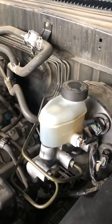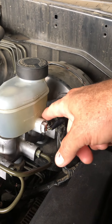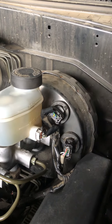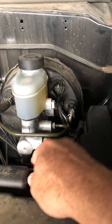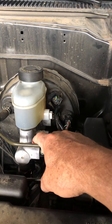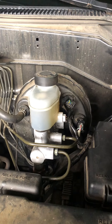The other thing I did while I was doing this — because the theme seems to be that the electronic connectors are getting dirty — is I cleaned the sensor to the float valve, and then I removed the connectors to the brake booster and cleaned them as well. I'm not sure this is a permanent fix. My plan is to come back next time I'm with this vehicle with the pressure sensors and the master cylinder ready to replace if needed. I hope this helps you out, and thank you to all of you who post these videos — it's been very helpful to me.